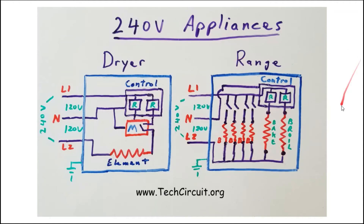How would you troubleshoot a range that has no broil, where everything else works? You've already confirmed 240 volts at the terminals and verified the broil element resistance checks out. You suspect an open circuit somewhere in the broil circuit path. The method to use is called the point-to-point voltage drop method: connect a reference lead and trace through the circuit checking for voltage drops. As soon as you find a voltage drop, the point just prior to it is the open circuit.